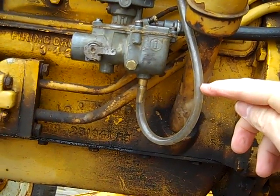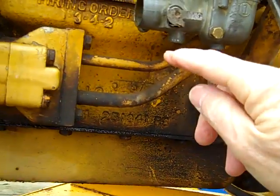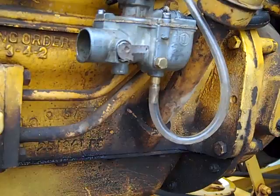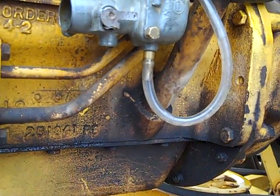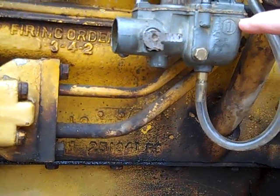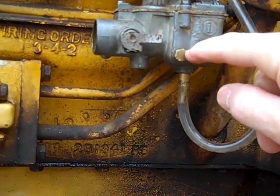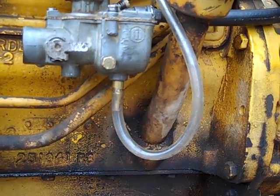This is the fuel level, and of course it's running out of fuel so it's dropping down. The engine's running very smoothly now because we're running out of fuel. So obviously the fuel is not coming up over the float — it's coming into the Venturi through the main jet assembly or some other leakage.